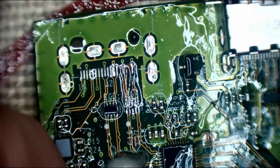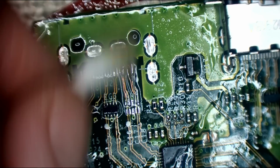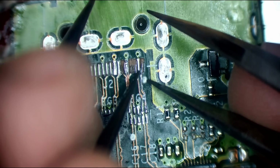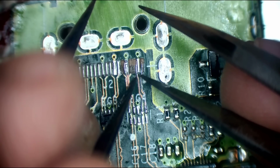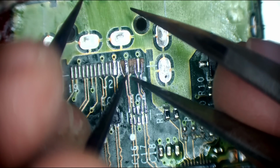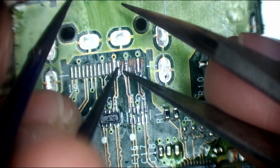And it'll basically be a permanent repair even if you have to change the HDMI port again. As long as you don't yeet them again, whoops, like that, you'll be able to change the HDMI port without damaging the traces. So I know this isn't following the exact path, but it's as close as possible. It's definitely close. It's definitely within 3mm anyway. That's for certain.